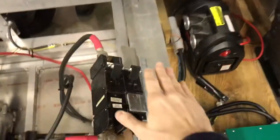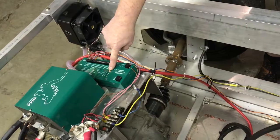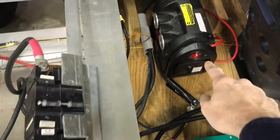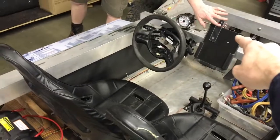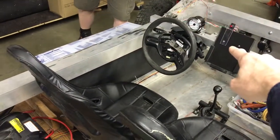Car number four here, Rich Rudman. Here's what I think I just learned — startup sequence: we would turn on this breaker, and you see there's no light on the hairball. Now there's a light because we just turned on the breaker. Then we would turn on the 12-volt power — we'll hear the fan start to come up in a moment. Then we would turn on the master key, which will now light up.